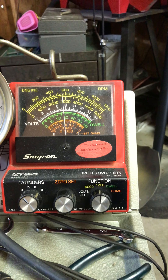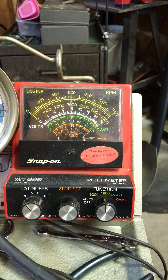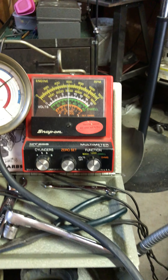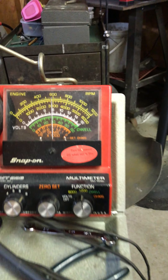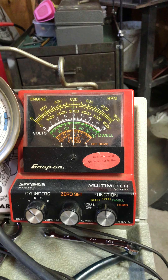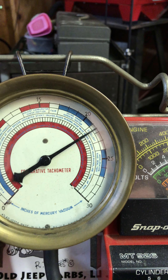About that — that makes for a little bit more. There you go. She gets warmed up — there's 600 RPM, vacuum is 21 and a half. Excellent.